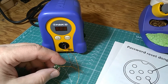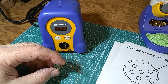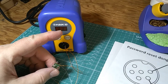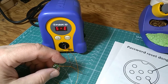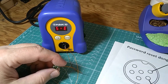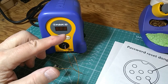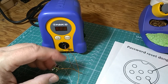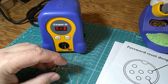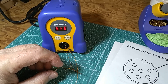This resistor is a substitute for the thermocouple, so it will read about 50–60 degrees. I'm going to push it again. The first press and the second have only a five-second or less gap allowed. However, once I press it I have to wait for the two temperatures to show up — the 370, which is the set temperature, and then the 50-something. As soon as it shows up, I release the button and then press it a second time, and wait for RST to show up on the display, which means the password reset is done.